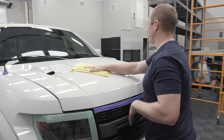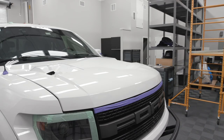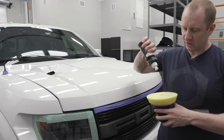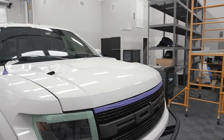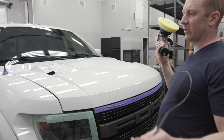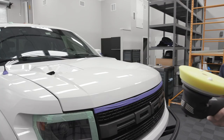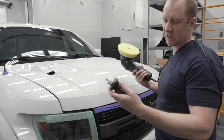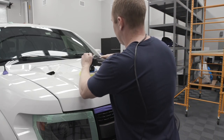And so the only real thing with finishing, and again, for you to see the difference, especially on white paint like this, would probably be impossible, but if we're going to do it, we might as well do it right and just use some simple logic here, that this is a diminishing polish. It starts at what they call a 4 and ends in a 6 or something like that. What do they say? Yeah. Starts as a 4 cut and ends as a 6 cut. So it breaks down. 6 meaning less cut or more gloss.